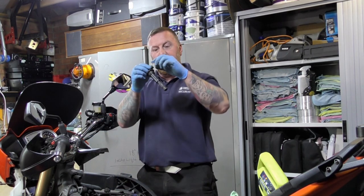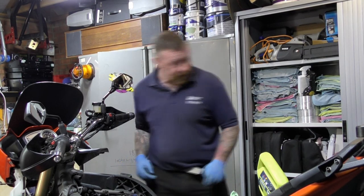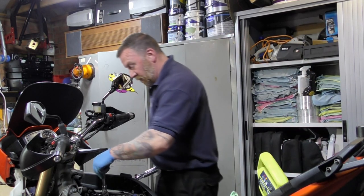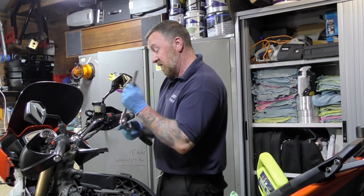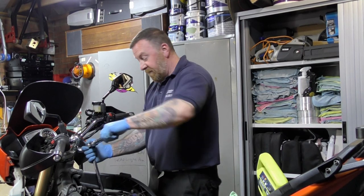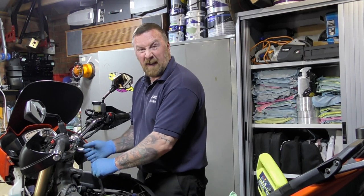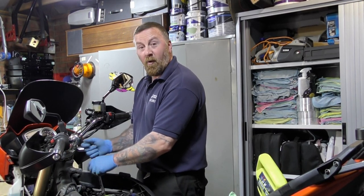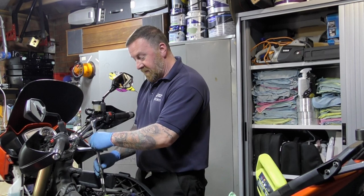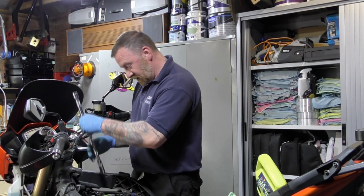It's often better to just disconnect that bit and pull them out. Now I do one at a time. I always have done. I prefer doing one at a time because you're not going to get them mixed up. Well, you're not going to get them mixed up anyway, but I just like doing them one at a time. I think it's an old thing from cars, from the old days. HT leads were all the same sort of length, so you literally could pull all four caps off, change the plugs, and then go, oh crap, I can't remember what way they were. So let's have a little looky.